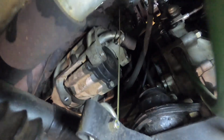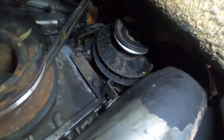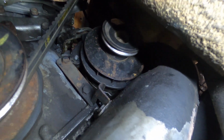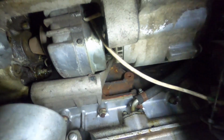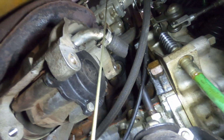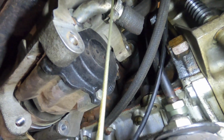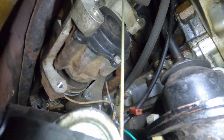So what happens is this alternator is run off the front of the car. There's a belt that goes across the little pulley on the alternator. The back side of it is attached to the emissions on a US car. So there's this huge aluminum bracket underneath where the header comes down, tucked up underneath the header on the outside of the V, that holds the air pump.